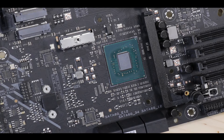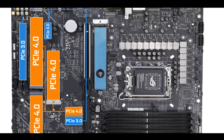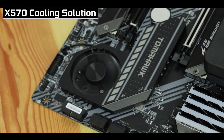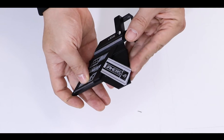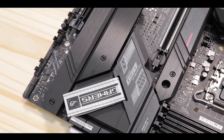Chipset-wise, we get Intel's first PCIe 4.0 supported chipset. It has more bandwidth and more lanes than its predecessor, but most noticeably, the Z690 chipset manages to deliver PCIe 4.0 standard bandwidth on a very cool 6-watt heat footprint — half of what AMD managed, and the infamous reason why AMD had to equip most of its X570 motherboards with expensive, sometimes noisy chipset fans, or more recently with large, imposing, and still expensive heat shields. In comparison, the Z690 heat shield is much smaller in area, costs less, and keeps the chipset below 45 degrees Celsius at all times — making PCIe 4.0 a more market-ready, more mature technology, easier to implement even on cheaper motherboards.